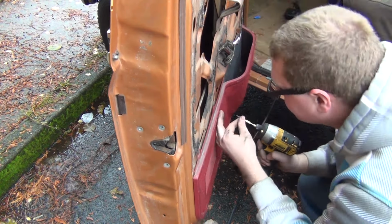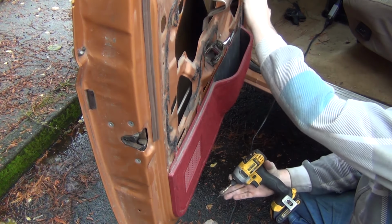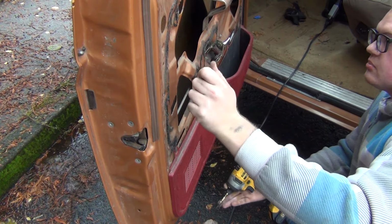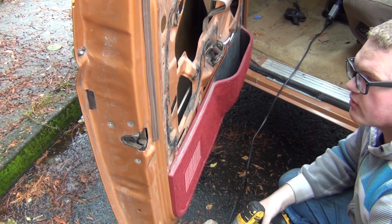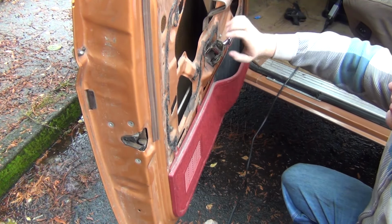Later I'm going to come in and add, I'm thinking of taking this part of the door that's covered and spraying it in a truck bed liner, or just cleaning it up really good and throwing DynaMat here, covering this whole hole up, do DynaMat back up in here, and then the speaker will have a baffle it's gonna go on, and at that point I probably will hog this out and put a 6-inch speaker in there, or a 6.5.